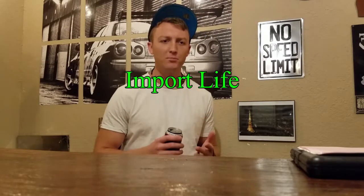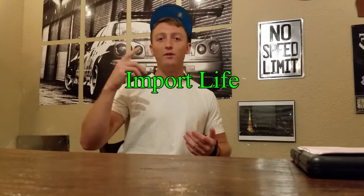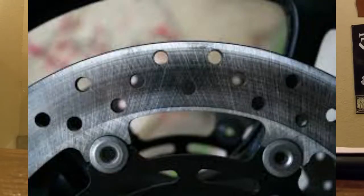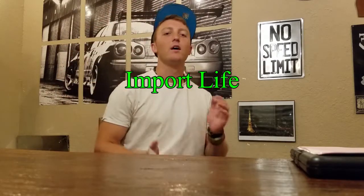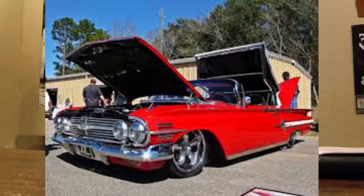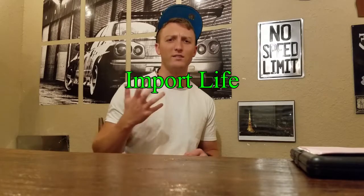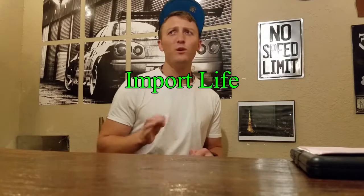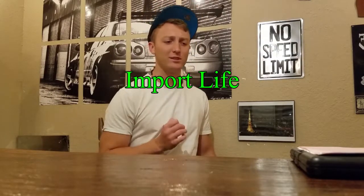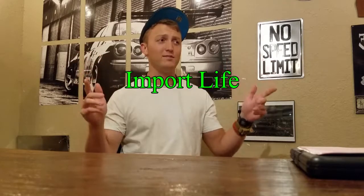A lot of people go with that. What are the different rotor types? Let's look at them. We've got drilled rotors displayed here — you've got the drill holes going along, usually offset from each other because when they wear, they start to wear unevenly causing some weird cosmetic looks. Drilled rotors were originated back in the 1950s for racers to decrease the rotational mass of their wheels and to allow brake dust and gases to escape through the holes, keeping brake pads from sticking to the rotors. We don't really have that problem anymore — that was with old asbestos brakes. Asbestos brakes got outlawed in the 1990s due to health concerns.